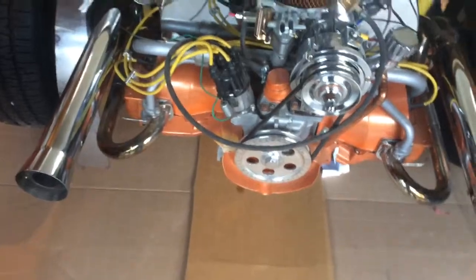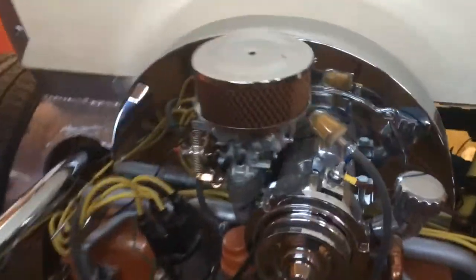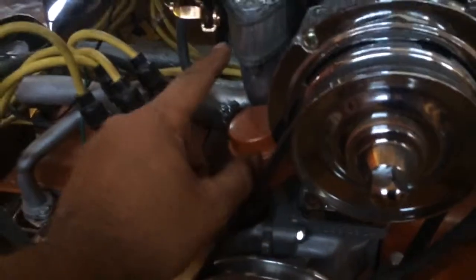I had an issue with the carburetor earlier in the year, and turns out I just didn't have these adapter bolts in all the way, so the nut wasn't coming through, so I had an air gap here. But when I took this off to restore it, this was all plugged up with carbon, so I had to drill a hole in on the side to clear all the carbon out, and then I used a little piece of metal and I welded it in. Turns out I have a pinhole leak back here, because I'm having a hard time getting my carburetor adjusted to run on a really smooth idle. So I think it might have to do with the air leak in there. Probably during the winter I'm pulling the motor back off, and I'm going to pull the carb and take the manifold back off, and then I'll fix that weld on there. I was thinking of using JB Weld, but I'm not sure.